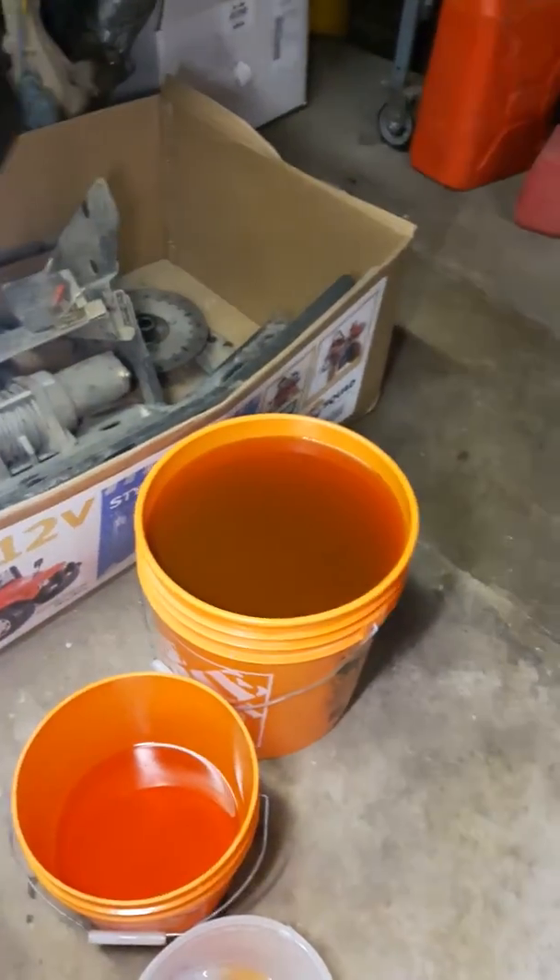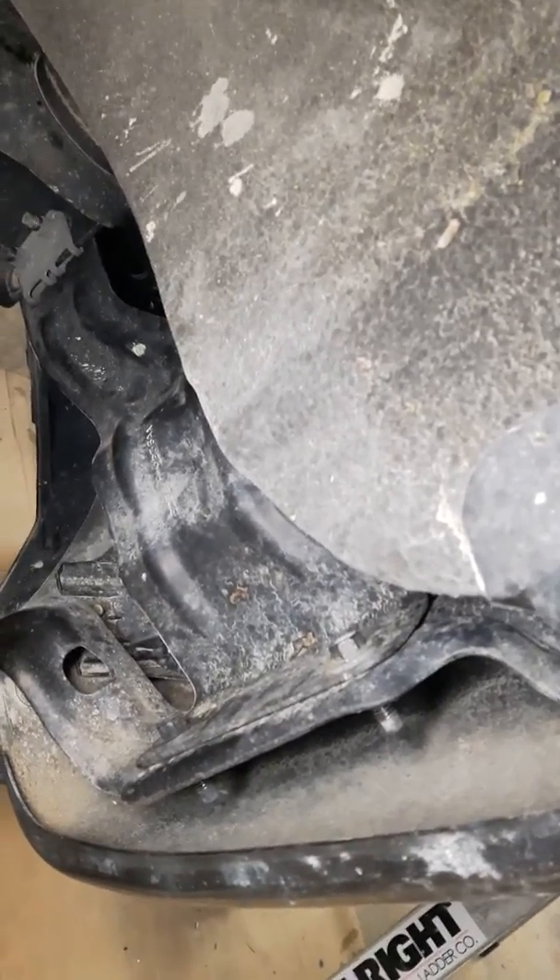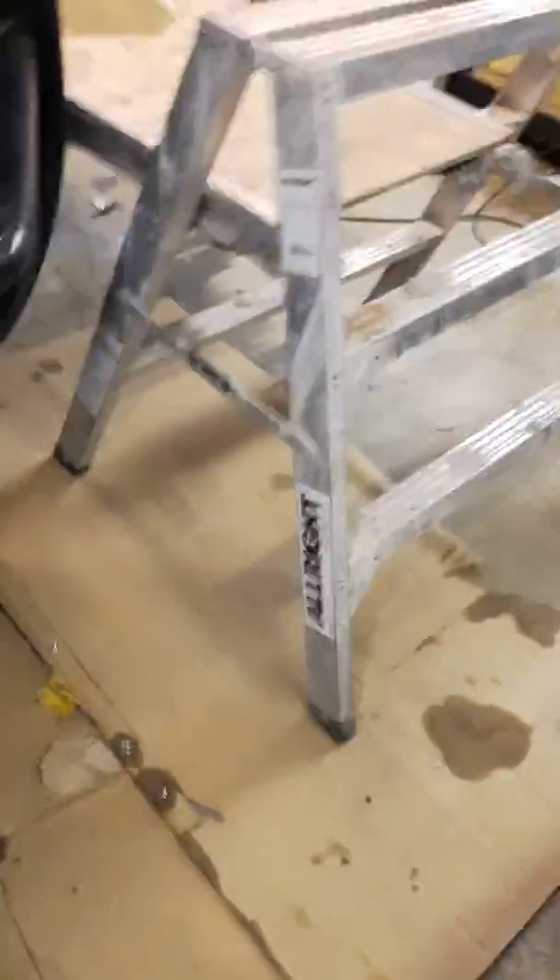There's probably 22 litres of coolant there. The other coolant petcock on the passenger side is really difficult to get at. I removed that bumper bracket to be able to get in there. Do the same — turn it a quarter of an inch and pull it out a bit. But you can also get at it from underneath the front, underneath the bumper.